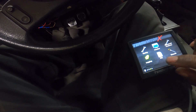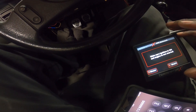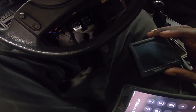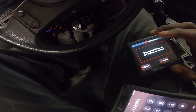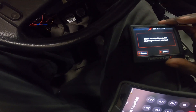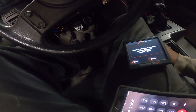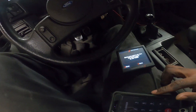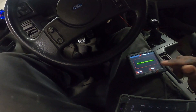We're going back all the way out of it? Yeah, back all the way out of it. Go to Wizards, then TPS Auto Set. Okay, TPS Auto Set. Make sure ignition is on, engine is not started. Go Start. Press pedal to the floor slowly, then release. One. Two. Next. TPS Auto Set was successful.